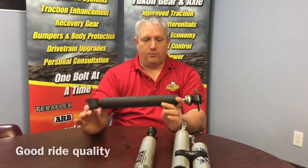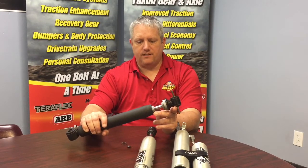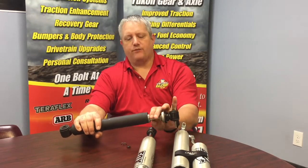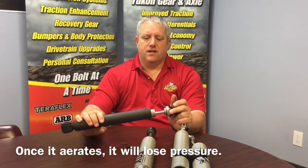This shock is going to give us a pretty nice ride quality — it's pretty low pressure in there, about 100 psi on a gas charge shock. As the fluid passes out through these valves, it pushes into the outside of the shock and displaces it. This gives us decent ride quality, but we've got two problems. One is that the gas charge itself is pretty light. Two is that we're mixing the gas and the oil. While you're driving down the road going to the grocery store on a nice flat maintained road, that's probably great. Where the problem comes in is we're usually driving over washboard, dips, potholes, things like that. When this shock moves back and forth and mixes the nitrogen into the oil, it'll aerate. Once it aerates, it loses its ability to create pressure and we suffer from what's called shock fade.